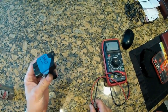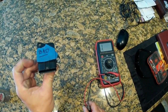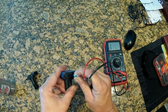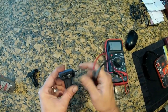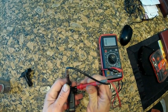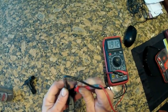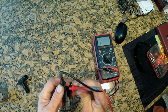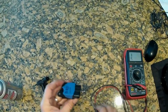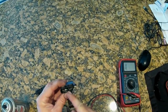Now we're going to measure the one that is damaged. By the way, this was brand new — I got maybe a couple hundred miles on it. I was doing a blow-through MAF setup and of course I got some oil in it from my turbo, so I decided to clean it. Same thing — put the clip in the middle and measure resistance. The last one: I'm getting 1.9, a little bit higher, but that's not the bad part. The bad part is when I measure the next one — I get nothing. Somehow, spraying this stuff on the delicate thin wires damages the conductivity between this pin and this pin.